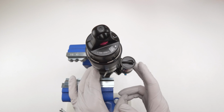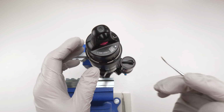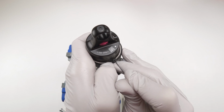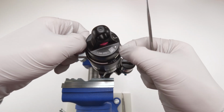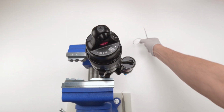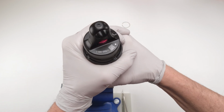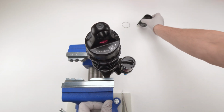The shock is now mounted on the vise. Next, we want to open it up. First, we're going to have to take out this little clip, all right? So if you notice over here, we have notches that sort of line up. Make sure those notches are lined up. Take the clip, move it over, hold one side of it, lift it up on one side, and you should be able to now take it and spin it all the way around till it all pops out. Take that, put it on the side. Then make sure that the can is lined up with those notches, and we're just going to pull up. And out comes the air can, all right? Take the air can, we're going to put it on the side.